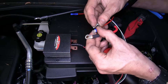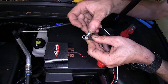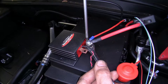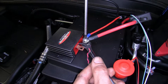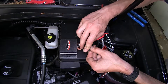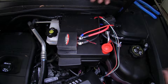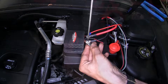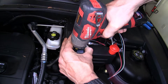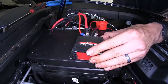Now we'll take our Phillips head screw, go through the ring terminal on our small fuse holder and the ring terminal on our large fuse holder that goes into our fuse box, and through this terminal on the module. We'll hold the nut still with a wrench and tighten the screw with the screwdriver. Now we'll take our large black wire that goes into our fuse box, place a screw through it and through the other terminal on the module, top it off with a nut on the bottom, and tighten the hardware. We found that in addition to the tape, we're going to need to put some screws in to hold the module down, using the provided screws to keep it secure.